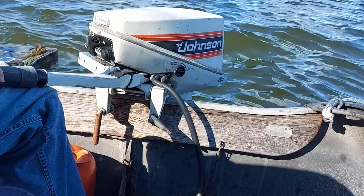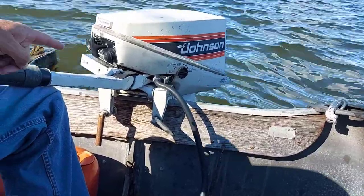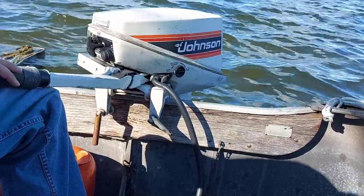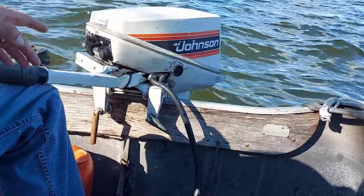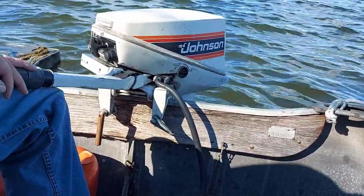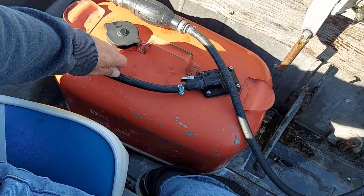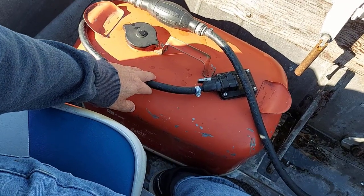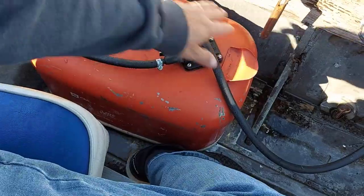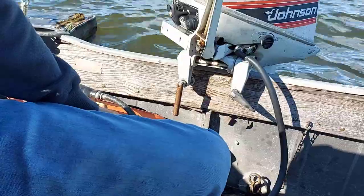I have this on my boat right now. I have an older 1980s Evinrude 4.5 horse, but my father got this motor from his friend — he wanted to see if my dad could get it going for him, and he did. What he did was he cleaned the carburetor, took it off, cleaned it all out good, put it back on, put new spark plugs in it. The gas tank and hose came with it — he flushed out the tank, cleaned it up good, put fresh gas in there, and cleaned out the fuel line and the bulb. Make sure it's all good fresh gas, nothing old left inside.